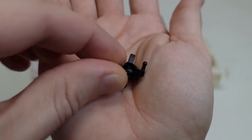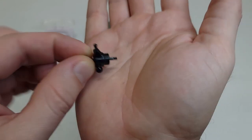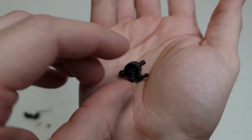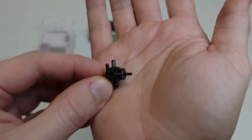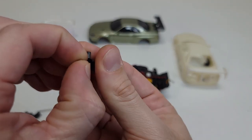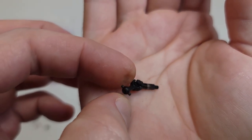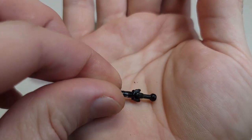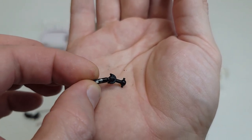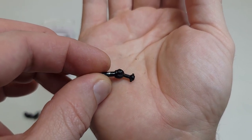And then this is the old 1-degree camber knuckle I had on there from Stage 1 upgrades. And then we gotta take the swing arm out. This plastic one from the stock setup. And we're gonna put the metal ones in. So we have two bearings in there. Just pull this out and see if one of the bearings comes with it. Nope, okay. So you can see, I think it might have a little bit of metal on it, like this part's metal, but that part's plastic. But I'd rather just have an all metal swing arm. Yeah, these don't look like they're gonna last too long.